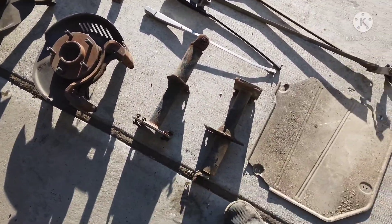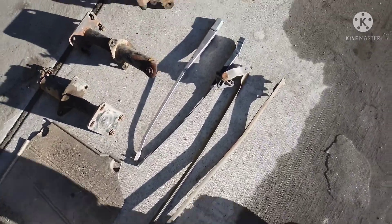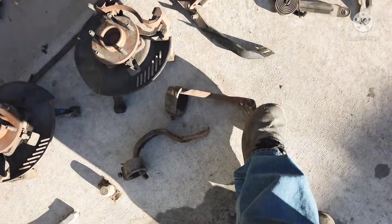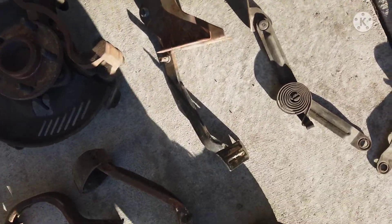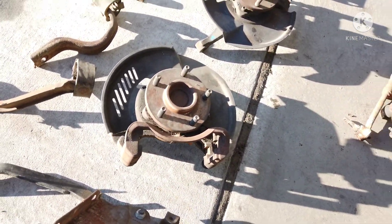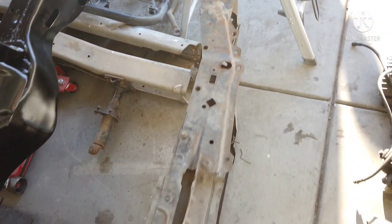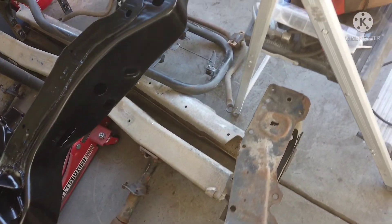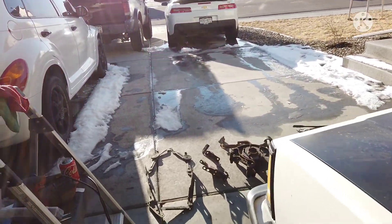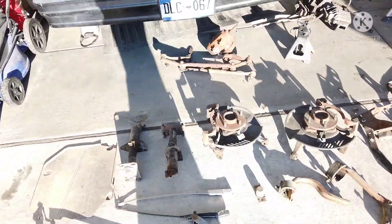While I'm cleaning those up and painting them, I'll also clean up the bumper shocks, that heat shield from the passenger side, windshield wipers, exhaust hangers, the brake pedal, and the hood hinges. Just hit those with some sandpaper, then the same rust reformer primer, then paint or enamel. That's all I'll be doing today - cleaning them up, hitting the core support and the bumpers also. Looks nice out but the temperature's not quite there to paint, so hopefully it'll be nice enough tomorrow.